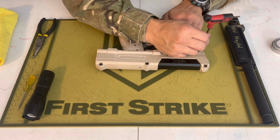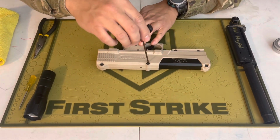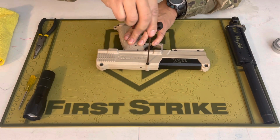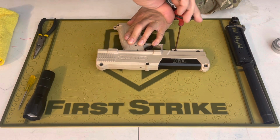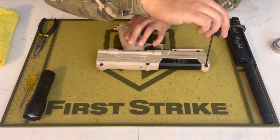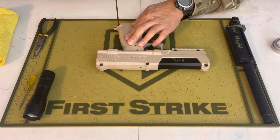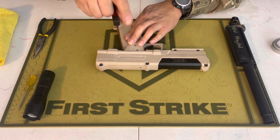Once I have all the bolts started, guys, then we can start tightening the bolts. And like I was telling you guys, I kind of go in a zigzag pattern, like if you were tightening down a cylinder head or cam caps. All right, guys, so there's no number sequence, but I kind of just do a crisscross pattern, guys, to ensure that everything is clamped down, tightened down evenly. Okay?